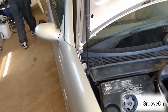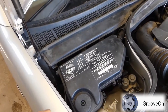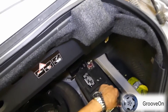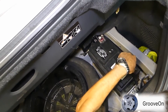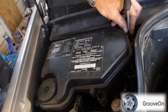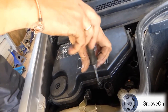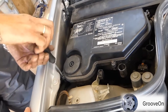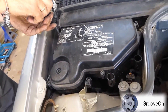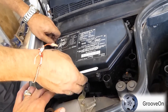This is actually a left-hand drive version of my car. You open the bonnet by pressing that lever and that gets it into the fully upright position, making it easier to work. Make sure you disconnect the batteries and leave it for a good 10 minutes to make sure there's no residual charge. Then simply unscrew the ECU cover - it's a Pozidrive 2 to undo those screws.